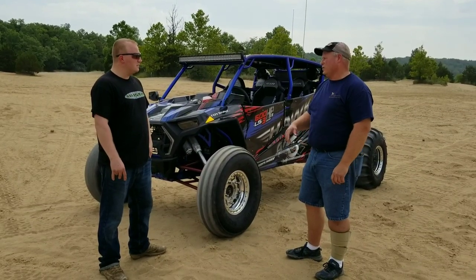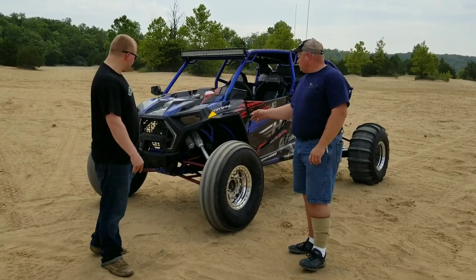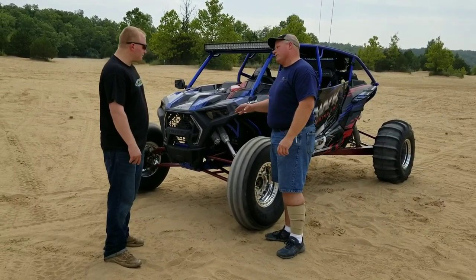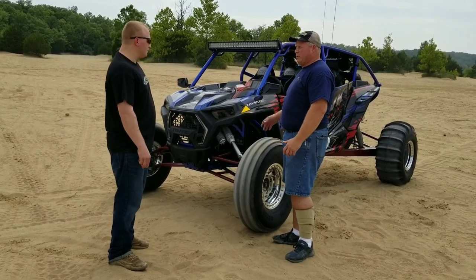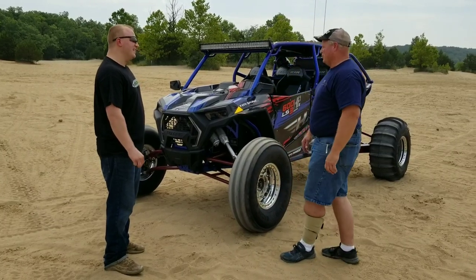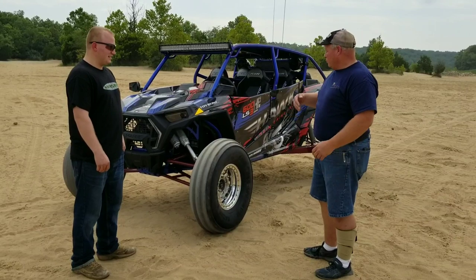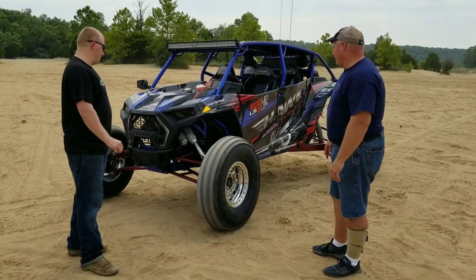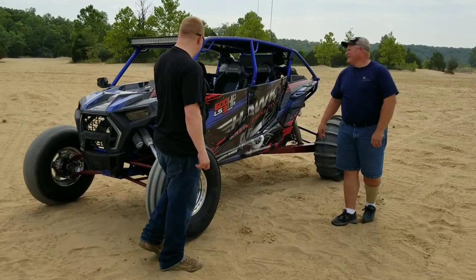We got the LS3 and the transaxles back in it. Up front we used a plus three-and-a-half inch Fireball suspension — didn't want to reinvent the wheel there. We used ORI struts, they seem to be working really well. Of course today's the first day in the sandbox so we're going to see how that works out and do some tuning. It does not have any four-wheel drive up front, so there's weight reduction there with the axles and the differential. We did put the battery up front to help with front-end wheelies.